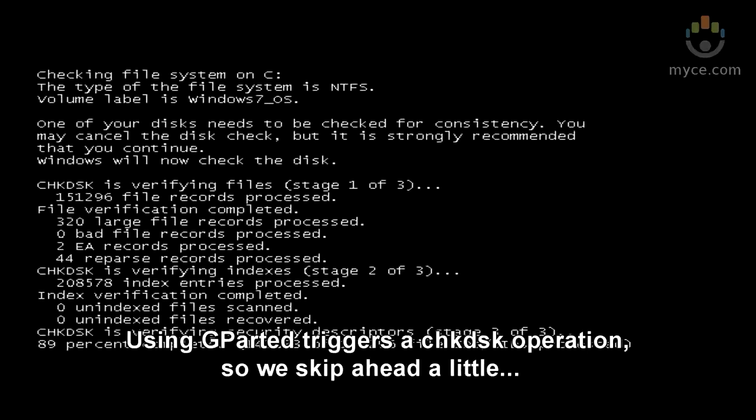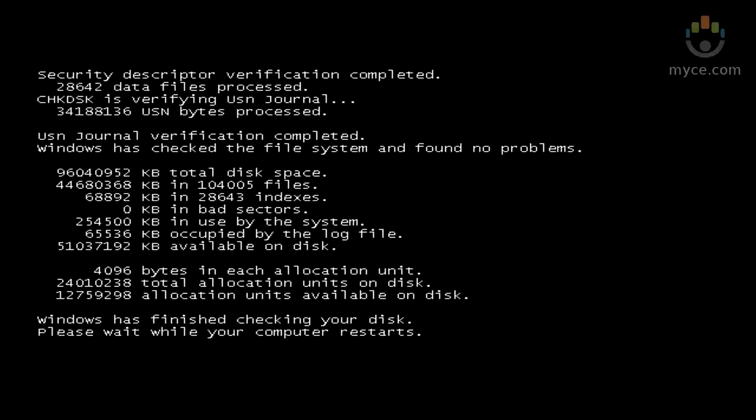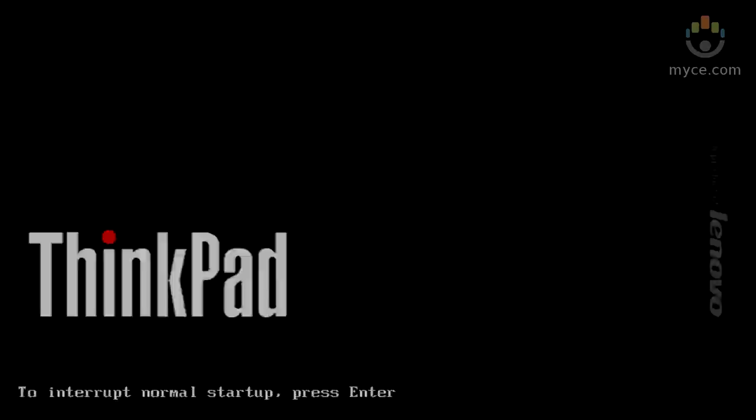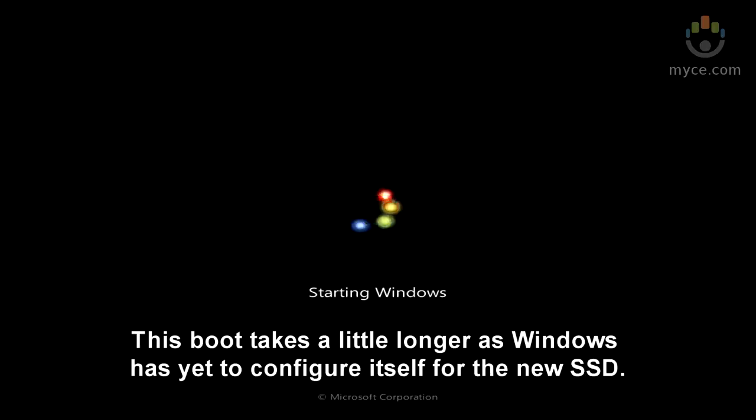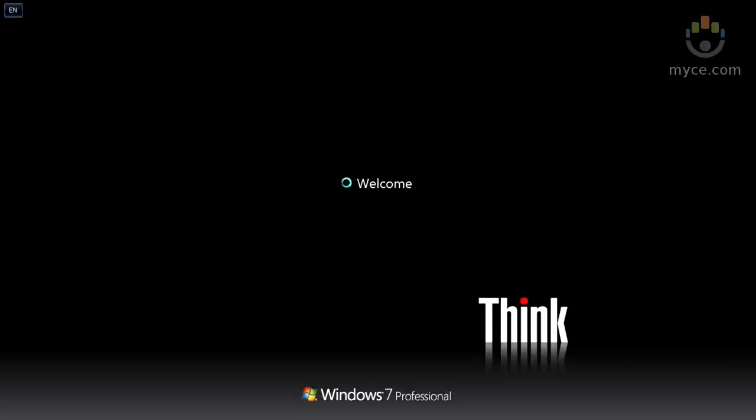As I was creating this guide, one issue I ran into is that this laptop has a 7mm height bay, but I'm using a 9mm solid-state hard drive. For those wondering how I managed to fit it, I dismantled the solid-state drive and put the PCB directly into the bay. While this may seem like a useful workaround to fitting a 9mm solid-state drive into a 7mm height bay, it's worth noting that dismantling a solid-state drive usually voids any warranty on it, but may be useful to fit an older solid-state drive lying around into a newer laptop.